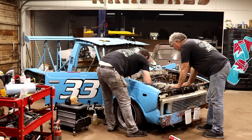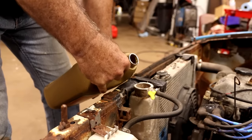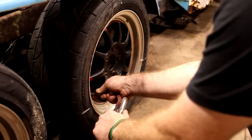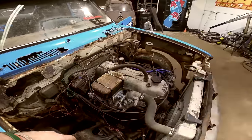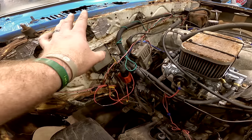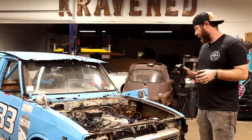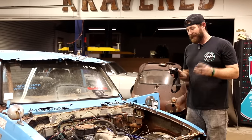So we went ahead and tried to button up the wiring underneath the hood of this truck, if that's what you even want to call it. Topped off the radiator with some fresh water, got us a bigger temporary tank that we've rigged up on the back of the truck, and shot a little air to these flat tires. Now we're just going to go ahead and try to drive the truck, and hopefully it'll go in gear. As you guys can tell here, we've got our little air breather zip tied on there. This wiring on this truck is just a mangled mess. There's really not a lot you can do other than just starting over fresh. But for right now, it should do the job of just cranking this truck up and being able to drive it down the road. Now, as you guys saw, the oil is a little questionable.